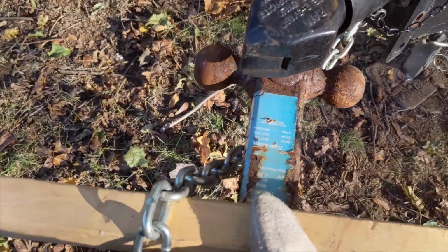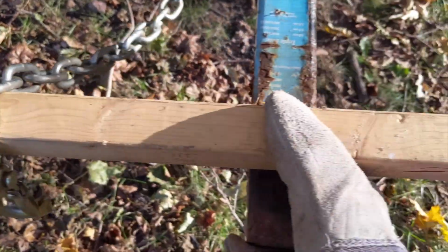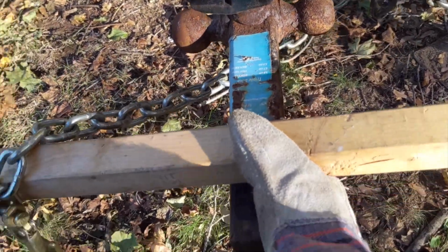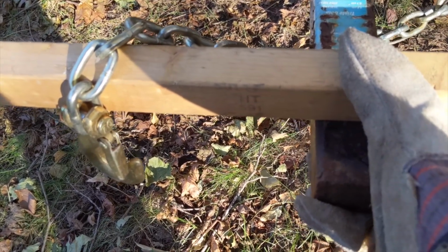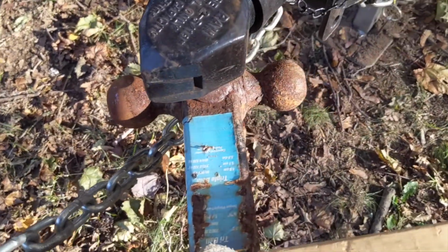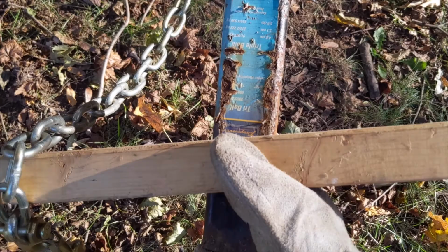The problem is much, much worse if, instead of being fairly straight on like this, the connection point for the chain is further out. So you see where there's an angle here, right? Now when we make this turn this way, you see it tightening up, tightening up, tightening up. And the chain, I don't know that the video caught it, actually slid back towards the hitch. So you go one way, you create this giant sag, which is bad. You go the other way, and it gets significantly tightened up, and it could actually bind. Both problems. Let me reset this, showing this crossed, and we'll do it again.